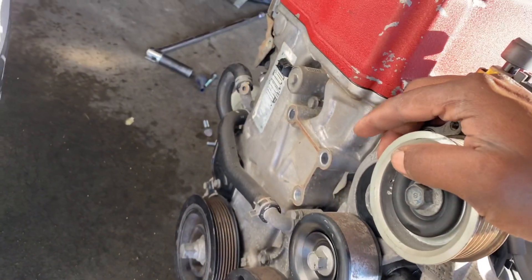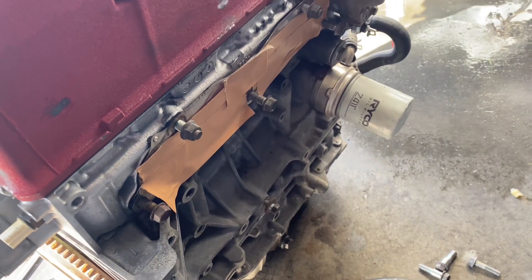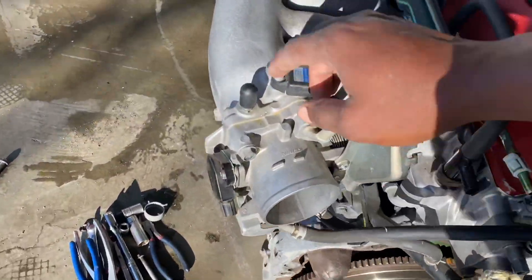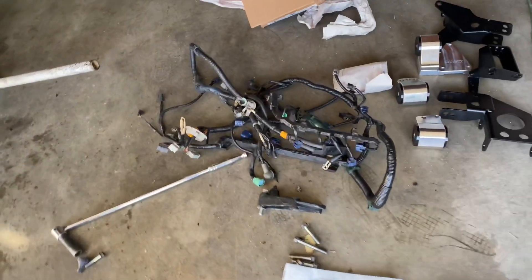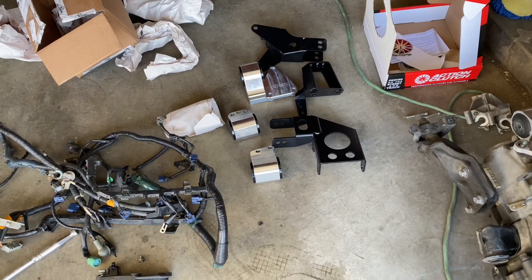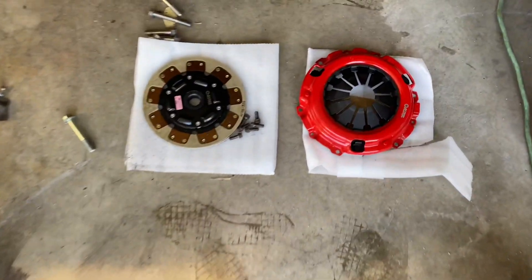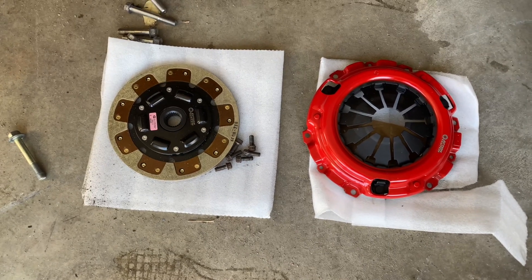We got the old clutch off already, took off the belt, and got the AC pump off. I took off the other bracket so we can throw on our Type S one, and also took off the half shaft so we can put the RSX Type S one on as well. All the little extra hoses are blocked off. So now we have the Type S harness, the charge harness, the EK-K4 Hasport mounts, and our Action Clutch ready to install.